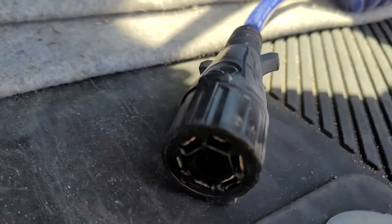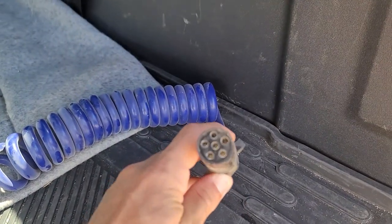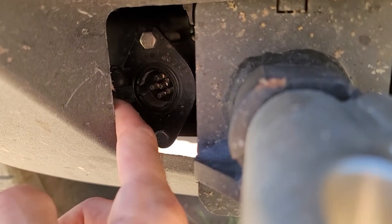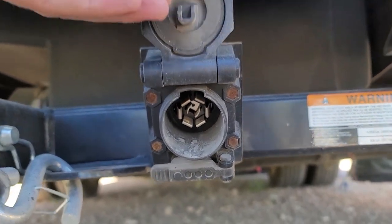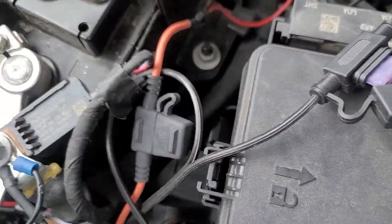You'll need a cable and a female receptor that gets mounted on the Bronco. This cable is what feeds the brake light and turn signals into your Bronco. It has to match whatever your tow vehicle came with — in my case, a 7-pin outlet. Additionally, you'll have to make sure to wire it in such a way as to allow the tow vehicle to charge the battery on the Bronco so it doesn't die while being towed.